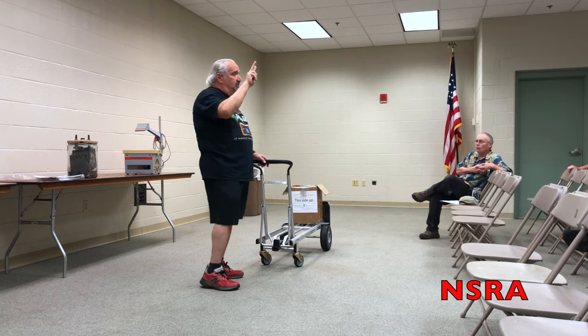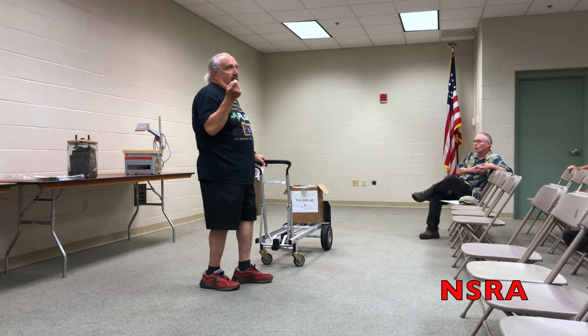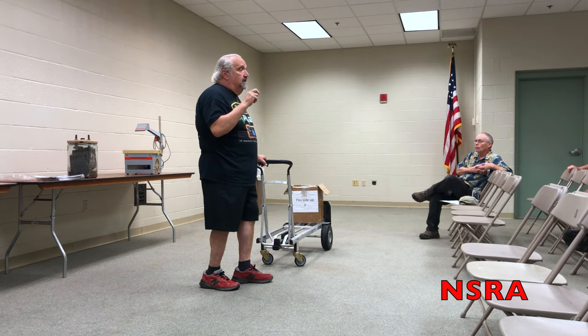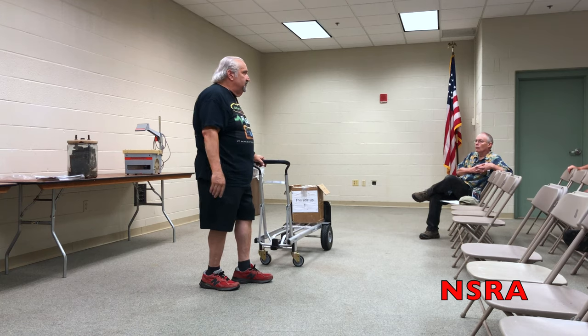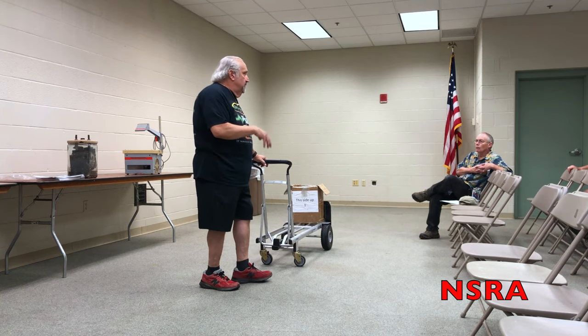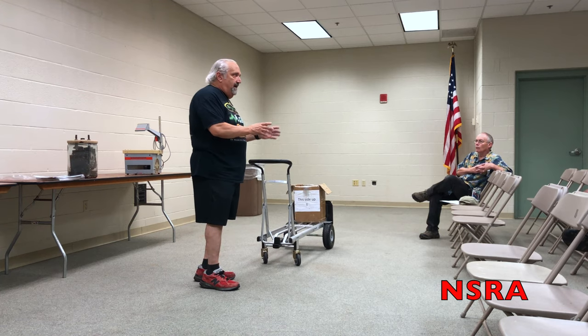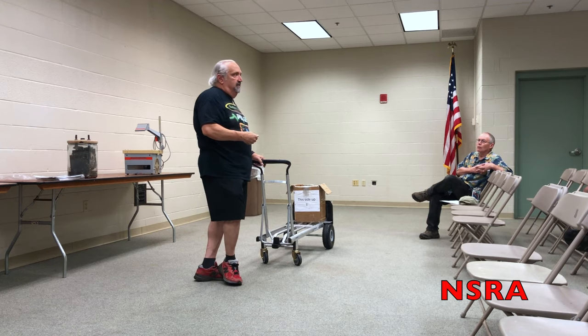Now let's just talk about the two things that you look for. There's a thing called amp hours, and there's a thing called cold cranking amps, and batteries are rated in both. And the cold cranking amps is exactly what it sounds like: the amps that a battery can produce at freezing. Okay, the higher, the stronger the battery. It doesn't mean that the battery is going to last longer as far as what you pull off of it. The amp hours can be smaller. It's just how much push it can give you to start a motor.